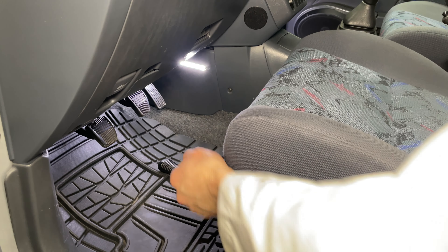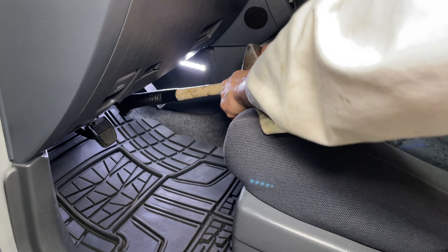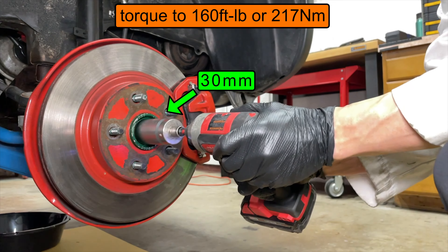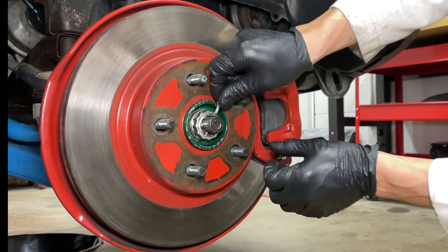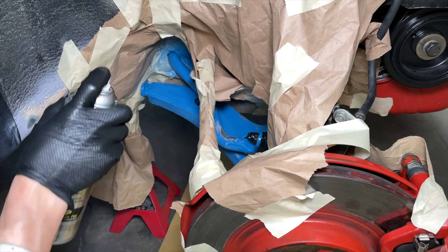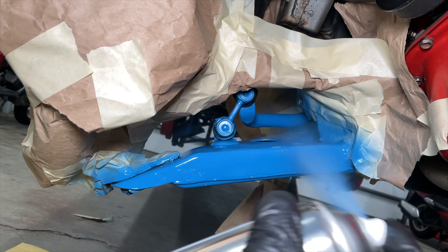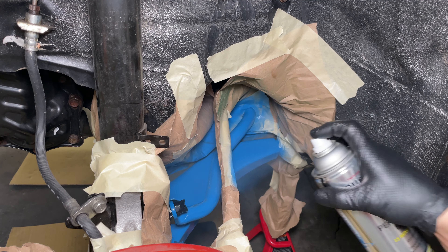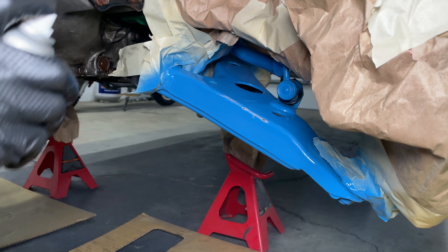Have a friend hold the brakes for you for the next step — my friends are inanimate objects. Install the front axle nuts and torque them to 160 ft-lbs. It's a good idea to grease the cotter pin so it doesn't get rusty later. So I dug myself a pretty big hole by making everything look good with crappy spray paint — the problem is this paint chips too easily. If I even sneeze near my car, the paint falls off. I guess I have to repaint the car every time I touch it. This rust-oleum paint sucks so bad.